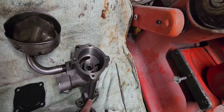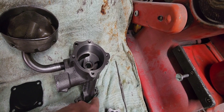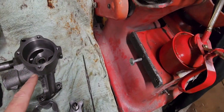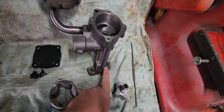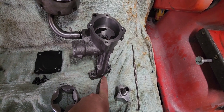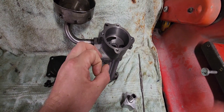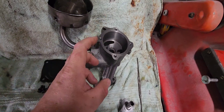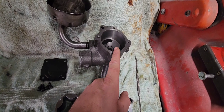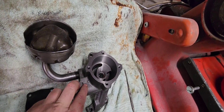So that's the basics of the pump: first to bring oil up into it, then to force it down into the oiling system. Any flow that is not going into the engine is bypassed and returned back to this side of the pump. The flow that goes into your oil system is determined by your clearances — namely your bearing clearances in your crank, your cam, the clearance between your lifters, and the hole size in the top of the rocker arms. If you make those bigger, you have more oil flow — the pressure doesn't change, you just have more flow.